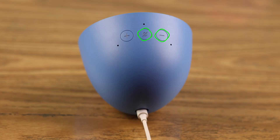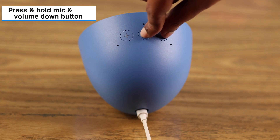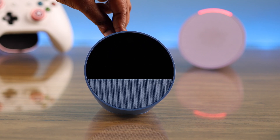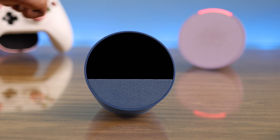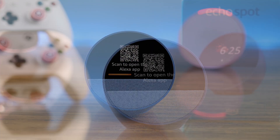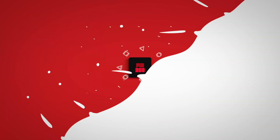You can also factory reset your Echo Spot from its buttons. All you have to do is press and hold the mic and volume down button. Keep pressing it for 20 to 25 seconds until you see a yellow bar at the screen of your device — that means the reset is in process. After the hard reset is successful, your Echo Spot will restart into setup mode with a QR code on screen. And these are the ways you can hard reset your Amazon Echo Spot. Thanks for watching.